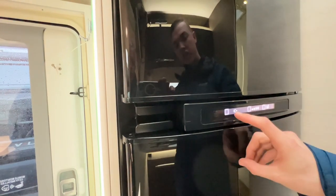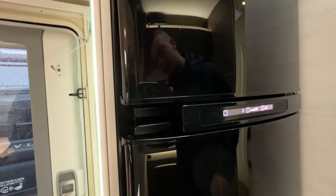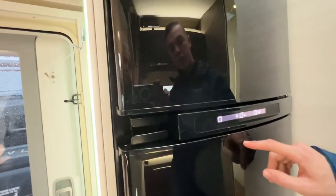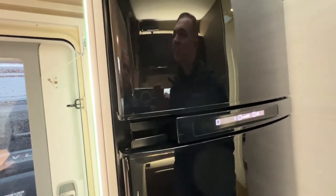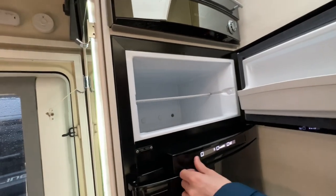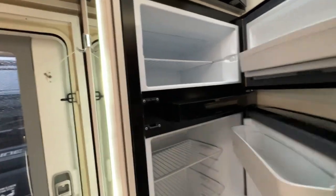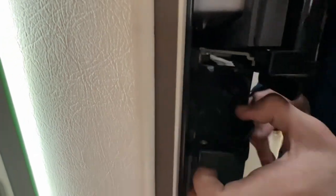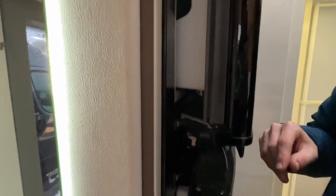If you're wild camping, press the square button to turn off 'A' and choose your source manually — you can light it on gas directly. Temperature runs from one to five: five is the coldest, one is the warmest. Set to five when pre-chilling, then turn it down to three or four once you put shopping in to avoid freezing contents. The frame heater setting stops the rubber door seal sticking when on full temperature. When not using the fridge, turn it off and use the small toggles to hold the door ajar for ventilation.